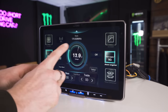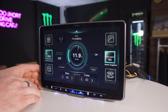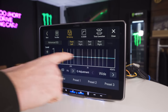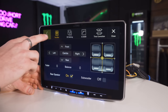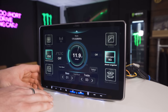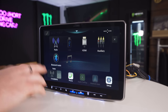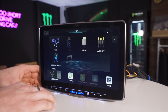What is quite nice about this one is it has a voltage meter, so you can actually check the voltage of your battery through the head unit, which is quite cool. The main sound settings you'd come to include EQ — you can change your EQ crossover settings, time alignment, fader balance, and loads of other settings. You have quick bass and treble adjustments if you don't want to go too in-depth. And up here is your phone — that's my phone connected there.